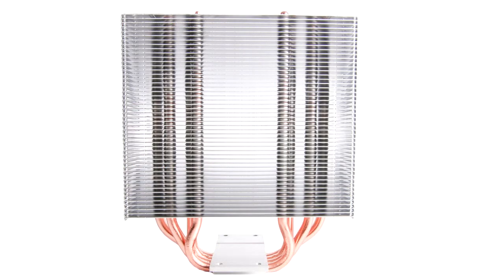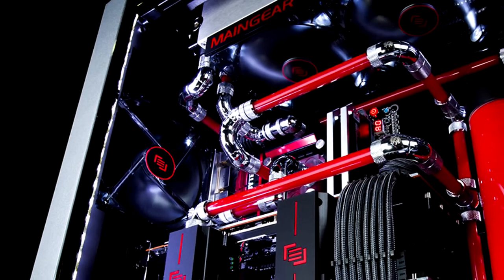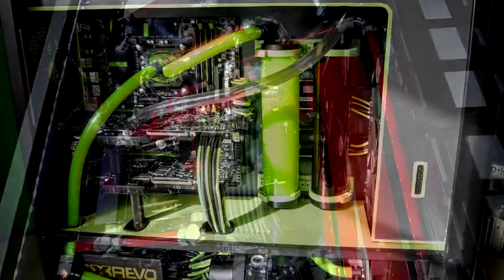In situations like these, the default heatsink is either inappropriate or over time will become less efficient at maintaining CPU temperatures within the recommended safe temperature zones. You could buy an aftermarket air-cooled system, but good ones tend to get big — very big. Depending on your case, it simply might not fit, and the additional weight can put unnecessary stress on your motherboard. In contrast, water cooling or liquid cooling, as it's often known, is considerably more efficient at wicking away heat because liquid has better thermal conductivity.